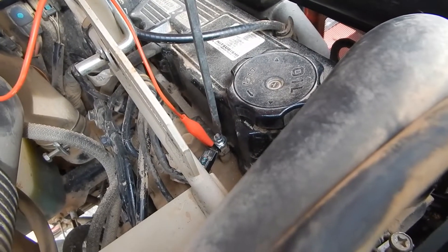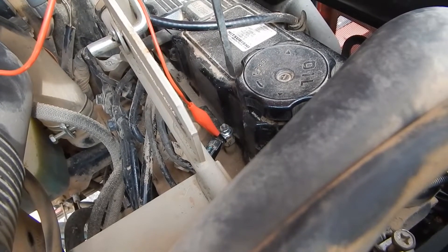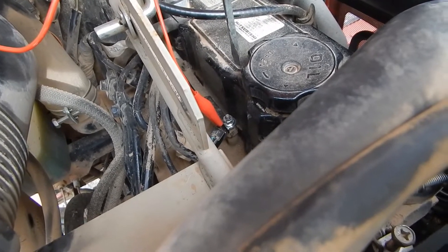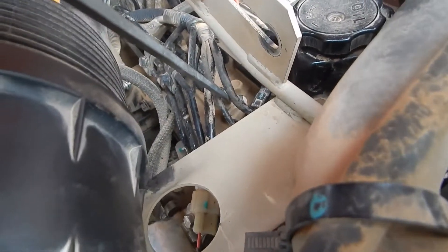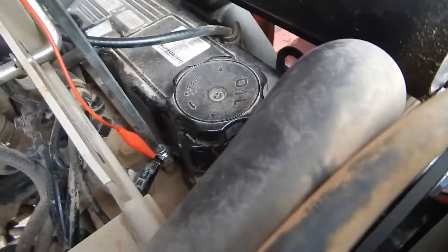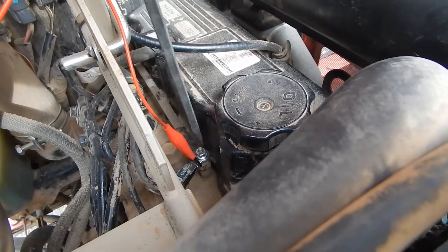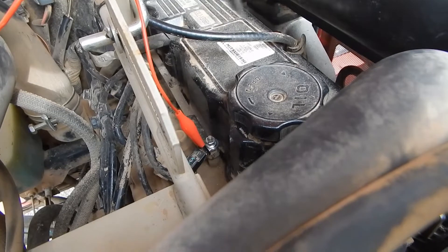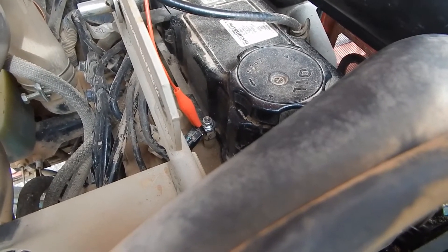These little glow plugs are like a tiny heating element inside — they look like a little red coil like a heater, lights up. They sit inside the pre-chamber, which is like a golf ball-shaped sphere cast inside the cylinder head, and those are called pre-chambers. These here are your injectors. These lines — that injector fires at the base of the glow plug, which is glowing red under a cold start condition, and that begins the ignition cycle. When these engines are cold, they won't start without the glow plugs.